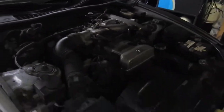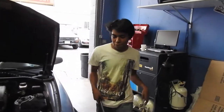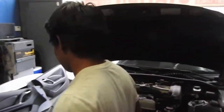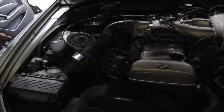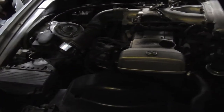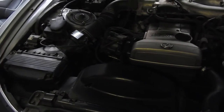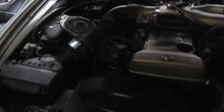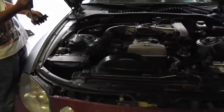I think he's cleaning the O2 sensors, and I think he has an EGR code, so that's what he's gonna work on today. He also ran into a little problem with his intake — the header is actually causing too much heat and melting some of the plastic underneath, so he needs to get a heat shield.